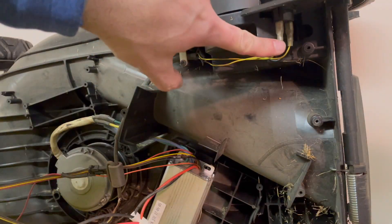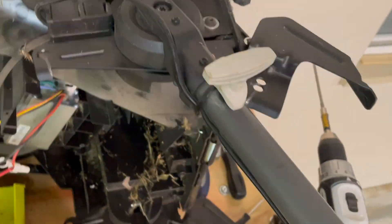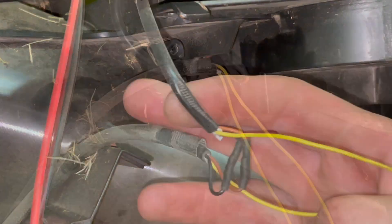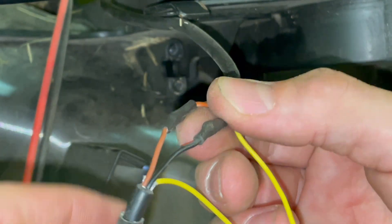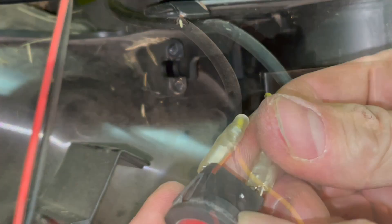So first we're going to test the actuator. That's a safety feature to make sure the handle is in the right position when it's in use. If it's in the wrong place then the circuit will be broken. To test it we just use a multimeter and make sure that there is no resistance when it's depressed. The yellow line runs through that actuator and the black and red go up the handle.